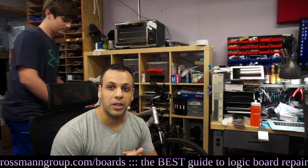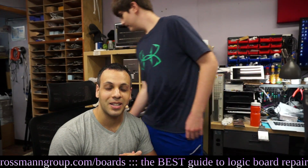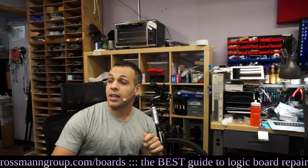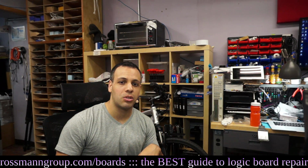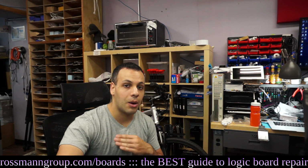And for all of those who are going to give me the response that Jason gave me of check pins 17 and 18 on the ISL 6259, go f*** yourself. I actually already bought myself a new controller. We're going to try getting rid of the hall sensor error because while the current sensing error will cause it to occasionally go out, I can still use it until I get the new controller. The error 8, which is a hall sensor error, causes it to not work at all.